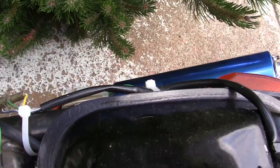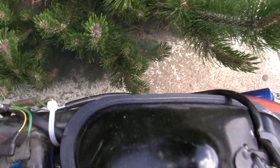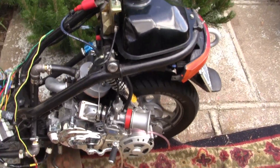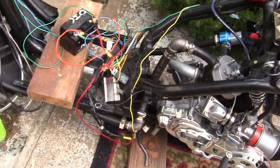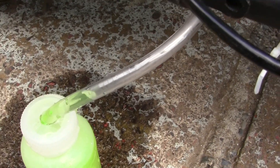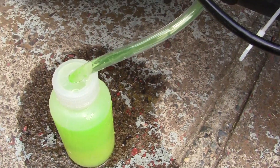The muffler's been rebuilt. I'm blowing some of the carbon out. It just quit — that's alright. It started. Now what'll happen is as soon as the engine starts to cool off — can you see this? This is what happens, I want to show everybody. The engine starts to cool off and the vacuum in the system wants to refill the radiator.